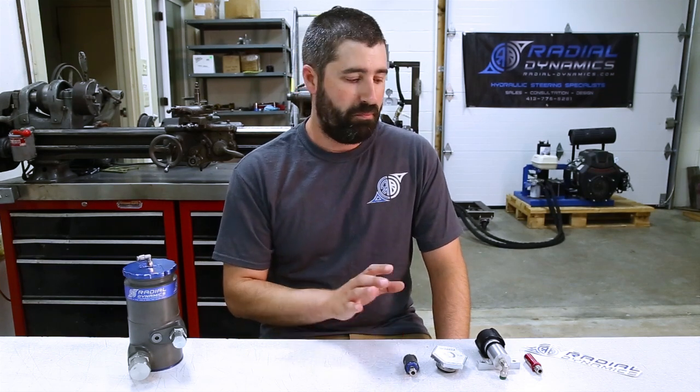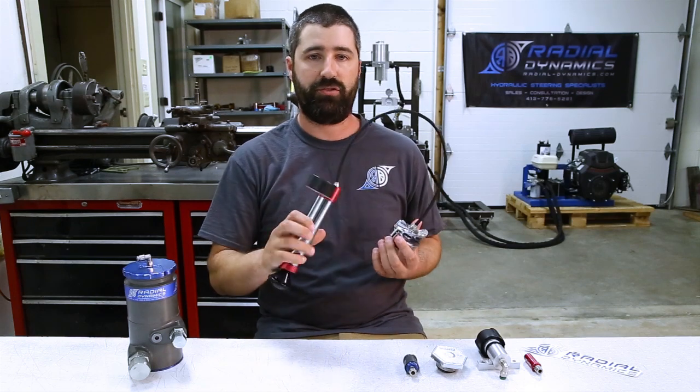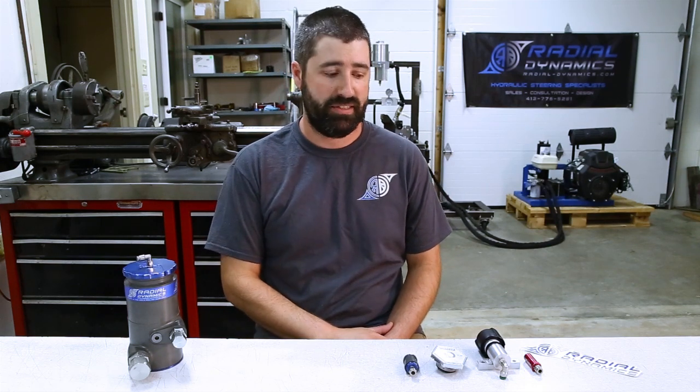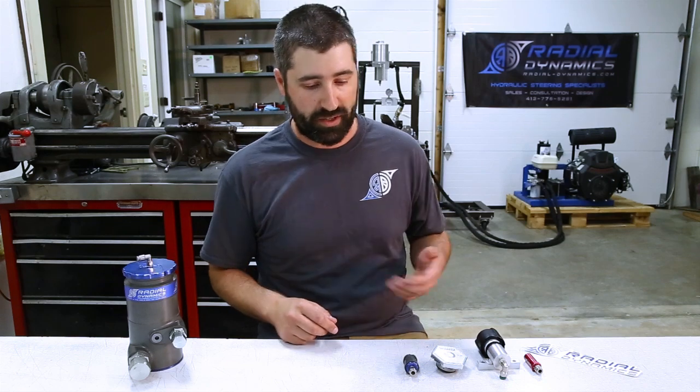As I've been developing this valve, I've learned a few things about all of these different pieces of hardware. I have to admit that for the past several years I've been doing all of this testing on the pump dyno behind me, using a radiator style or coolant system tester to build pressure at will and show how reservoir pressure affects pump cavitation — which has an impact on pump wear and pump noise. But what I haven't actually done is tested all of these different reservoir valves to see how much pressure each one actually ends up building inside of the steering reservoir. The results were not quite what I expected.